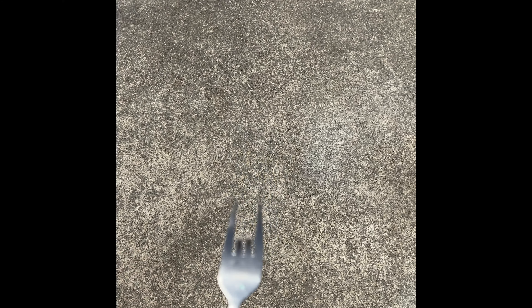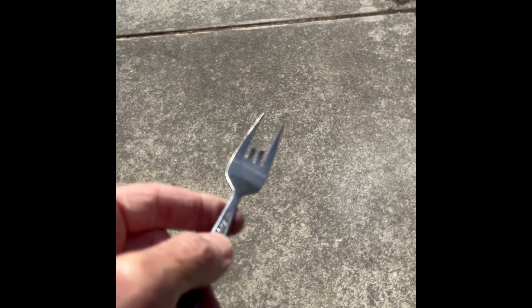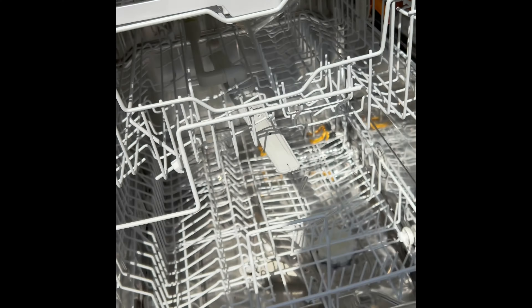To unfreeze the pump, we took a kitchen fork and bent back the front two tines a little bit until they broke off. You don't have to do that — you can probably just use a regular medium-sized kitchen fork. This is going to let us get in where the impeller is so we can turn it manually to free up its binding on the motor shaft.